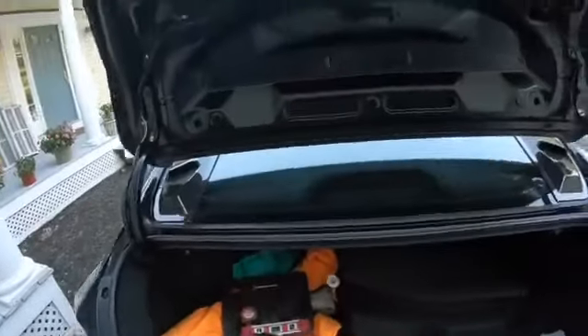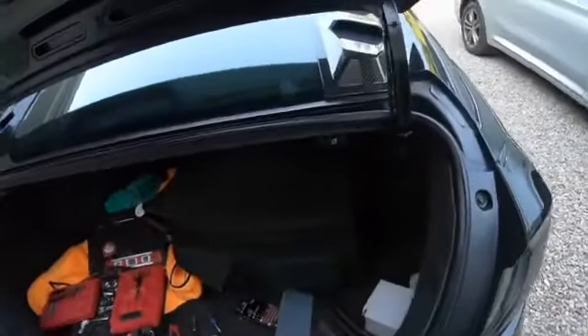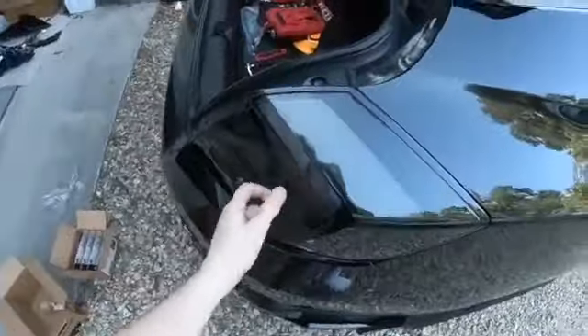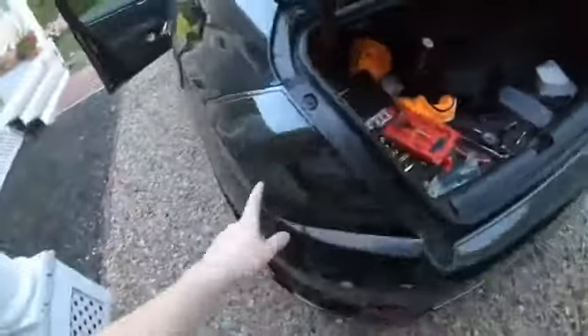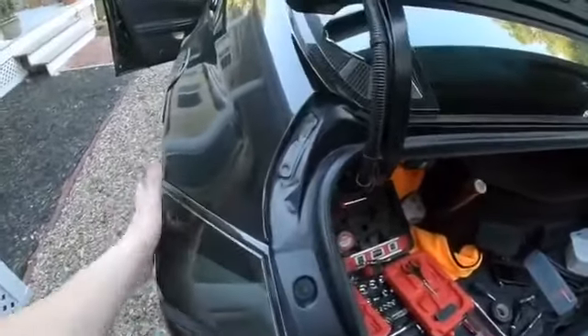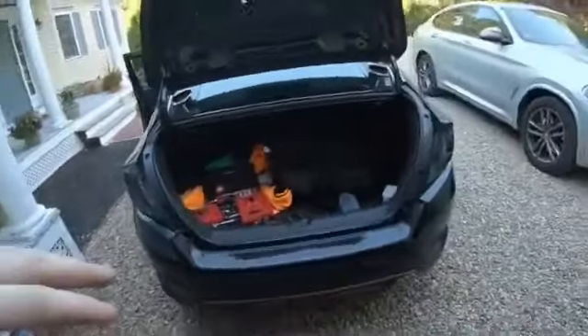I finished the second taillight but I did have some issues. You have to make sure the polarity is right for each light — I had issues with this one with the brake and reverse, as well as this one with just the reverse. You just have to switch those around in the opposite direction. Instead of screwing them in you want to clip them in so you don't need to do all that work — you just have to test them.